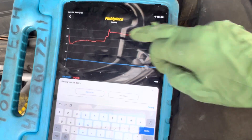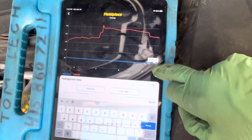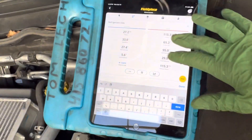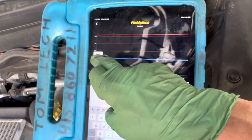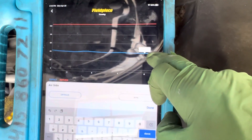We just had the fan kick to high speed, and you can see the high side pressure coming back down — just came down from a high of 150-some PSI to 119. Our low side is going back down; we're down to 27. Up here we were above 30, here we were at 33 at minute 6, and now we're at 27 at minute 9. We're back down to 38 degrees. The computer pulled the swash plate — if I had my dwell meter on here I could read the dwell — it's turning up the displacement so it could work more. We're down to 38 degrees now.